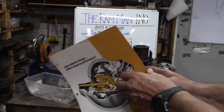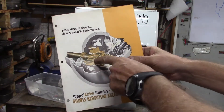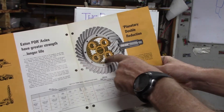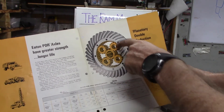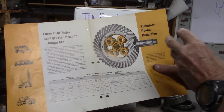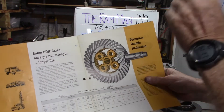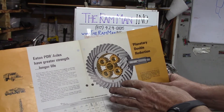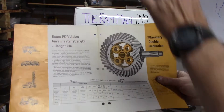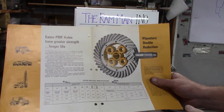Here's a little brochure from the 60s and 70s — this is an Eaton. Eaton's talking about the strength of the axles. They ended up putting a planetary assembly inside the ring gear itself — super smart. Because you do the reduction at the wheel ends, that's what takes most of the load. If you're running planetary wheel ends, everything upstream can be a lot lighter, simpler, and cheaper to make. That's the bottom line.